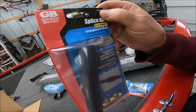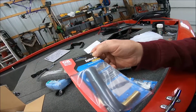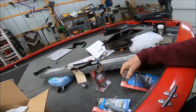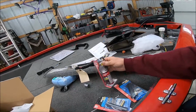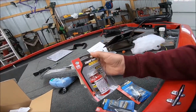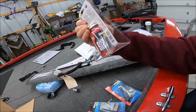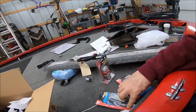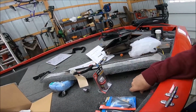Brass, you see the brass insert there with big large screws in it, and a piece of shrink tubing to seal it. I was going to solder, but I think these are going to work pretty good for me. And to make them watertight, I never used this before, but I'm going to try this stuff called liquid tape. And it's red. I'm going to apply it to the ends of the shrink tubing to totally seal these connections, which hopefully will do the job.